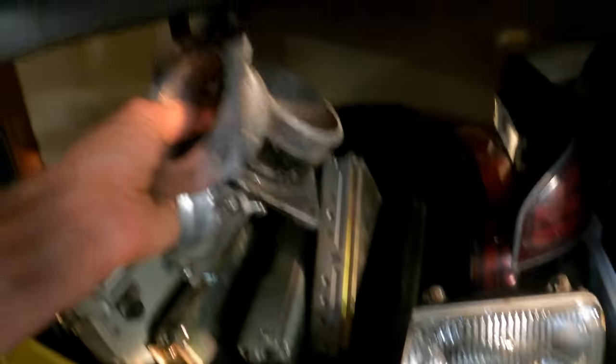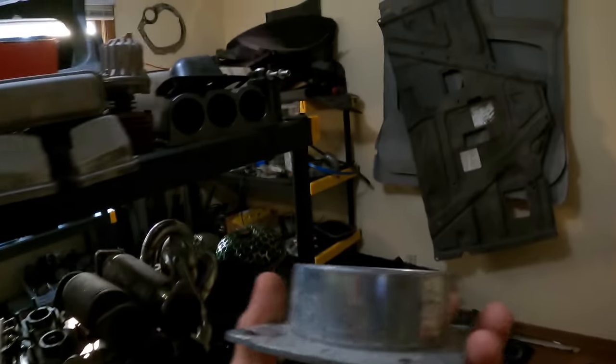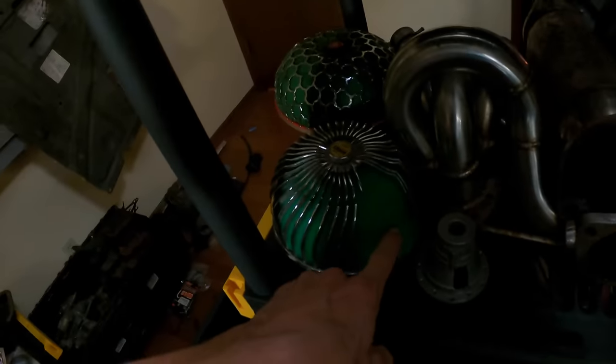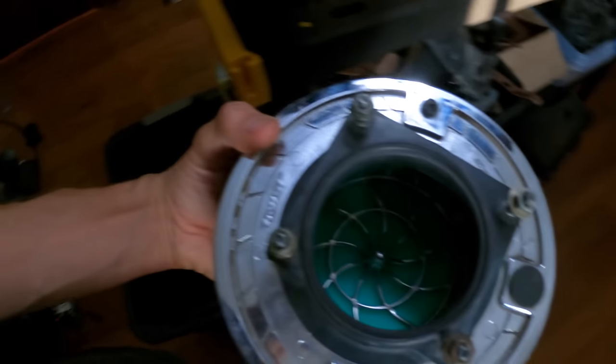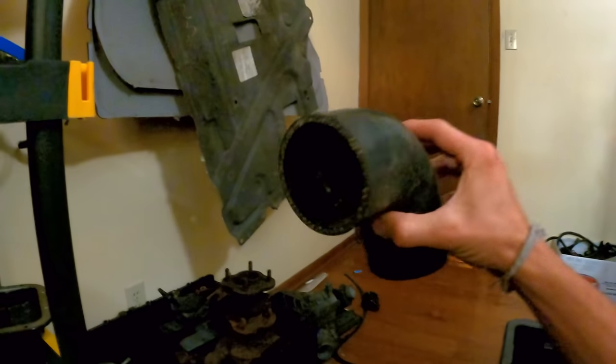Since Omar organized all his parts, everything is nicely placed. This is the MAF we need to match an intake filter to, and it looks like we only have two filters to choose from. One is way too big, and this one bolts directly to it — that might actually work, just the filter itself. Oh, it's busted. We might be out of luck for air filters, but we'll find a coupler to turn it down. This one was right on top of the coupler bin — looks like about 2.5 inch. We'll run with that.